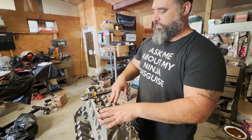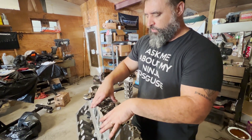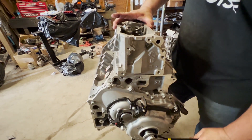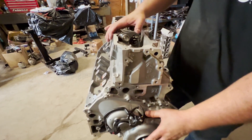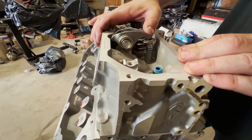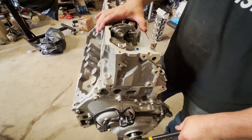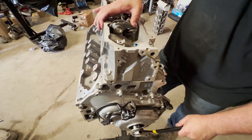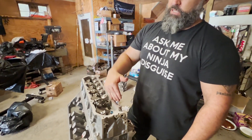Then the valve is gonna try to chase the piston down the bore. You can mock up without the gasket — sometimes I just like to go metal to metal so there's no fudge factor. We already checked it earlier, but for this video I'm just gonna hold the head down. What we're looking for is the push rod to start to move. Right there — it's just starting to move. Right now we've got about 300 thousandths of clearance probably. I'm gonna keep rotating a little bit more and start checking the distance — still got a couple hundred right there.